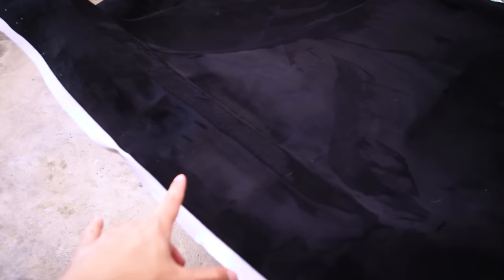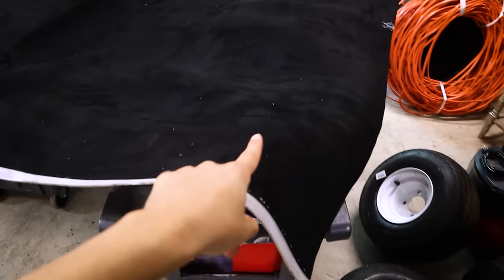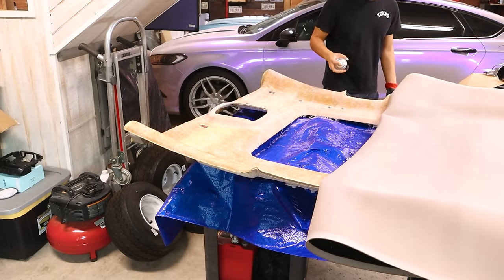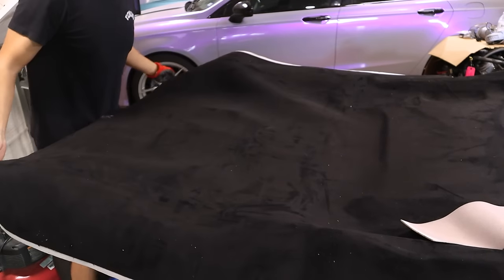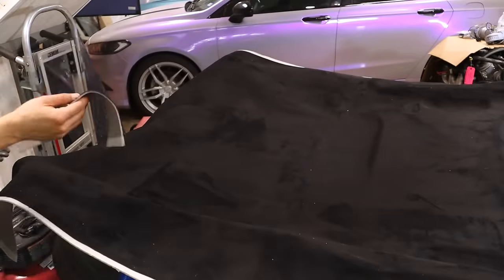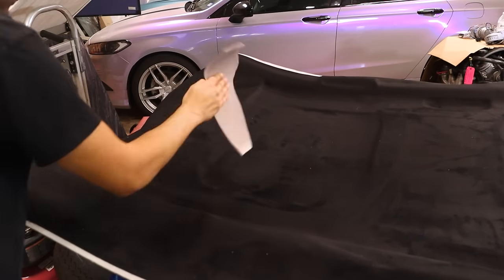This half has been laid and is looking good. We now have the other half laid down and it only took 11 minutes. The sunroof section and the flat section are the easiest parts. For the roof handles, you can go down and check that little opening to make sure you have the fabric laid against the hole — that's when you know you've got it pressed up against the edge. I'm very happy with how this came together. We're going to flip this over, make the cut of the sunroof section, and fold everything over so it'll be very flush.